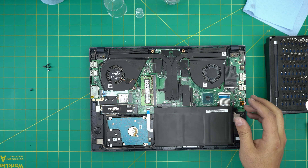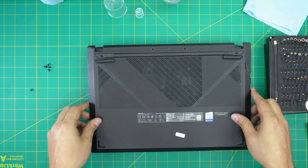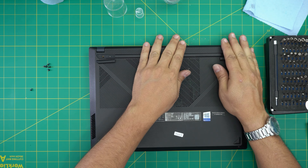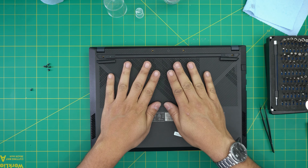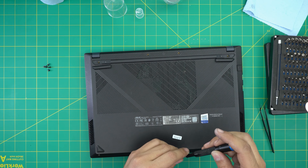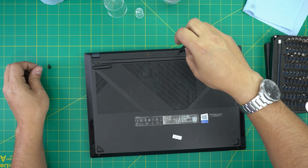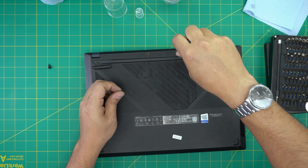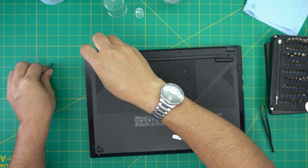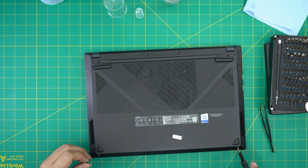The last thing is to grab the cleaned bottom case, bring it on top, set it down straight, and push the corners down, then the sides, then the back — you want to hear the click sounds. If you see any gaps, open it slightly and pinch them together. Once fully clipped, put the bottom screws back in and put the rubber legs back on. I hope this video helped you out — click like and subscribe to support the channel. If you have questions or requests, leave them in the comments and I'll answer them as soon as I can. Thanks for watching and I'll see you in the next video.